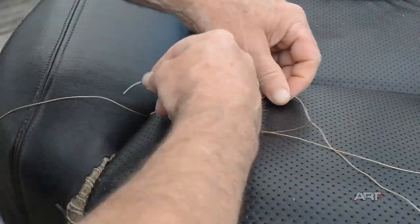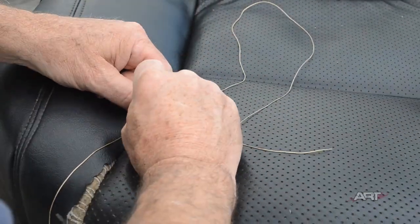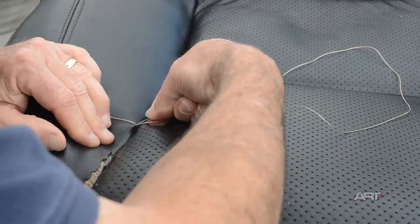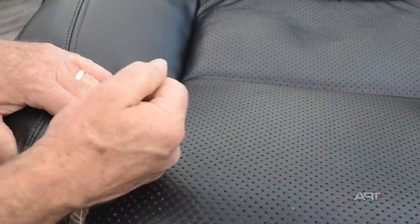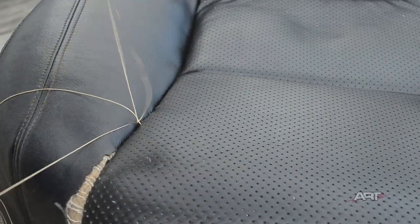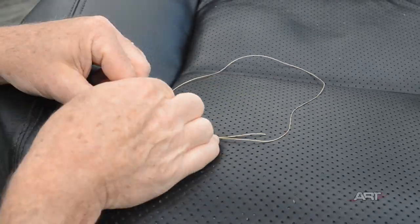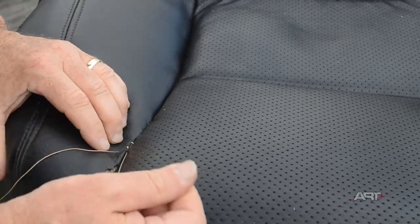The position of this stitch is also challenging. A seam in the middle of the panel is usually held down to the foam by means of hog rings, or sometimes even velcro, and this creates a valley. As you can see, we are stitching deeply in the valley, trying to maintain the valley in this repair. In some scenarios, the blind stitch will actually eliminate the look of the valley because you'll be pulling one side directly across to the other side and flattening out that little recessed area. So it was important here that we started deep in the valley and then gradually came out around our damaged area to try to keep this recess as deeply as possible.